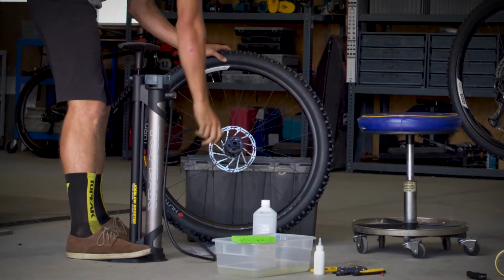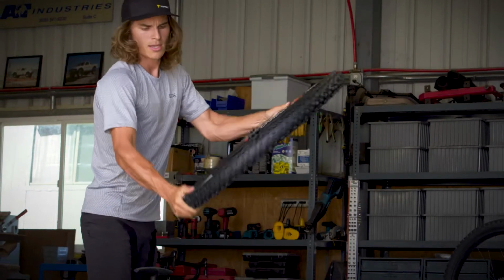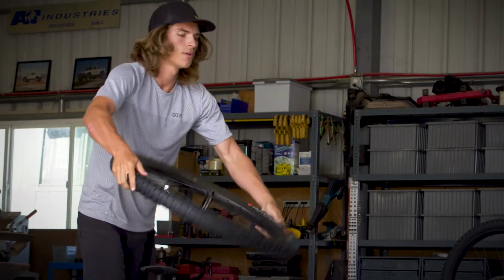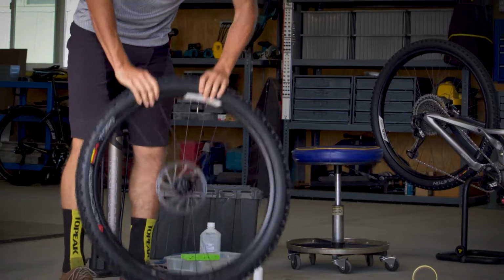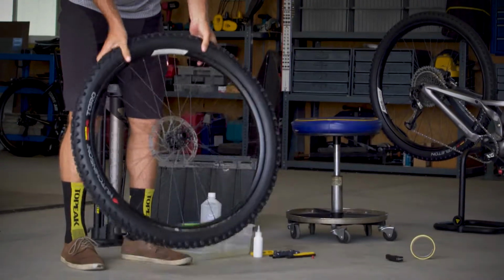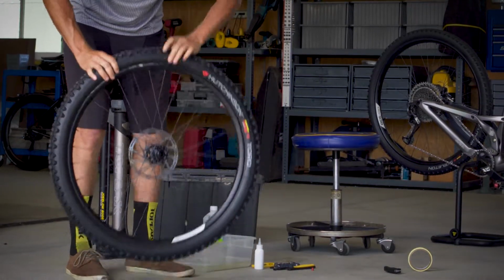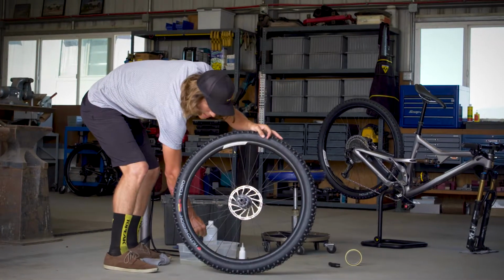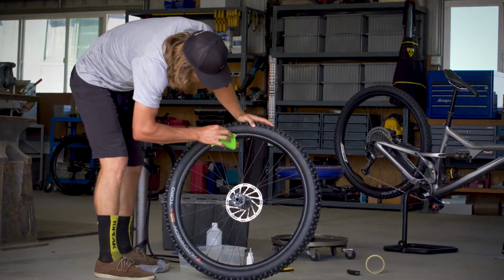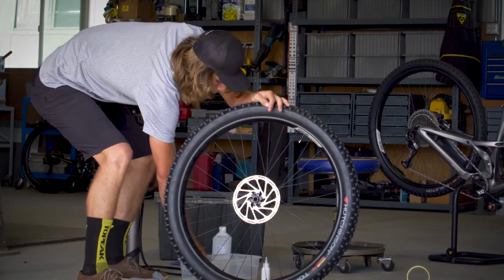Move our pump. And evenly coat the walls of the tire with sealant. Find that for problem areas, bouncing the tire quickly resolves it. So now we can take our sponge and soapy water and lightly coat the bead of the rim in order to easily inspect for leaks.